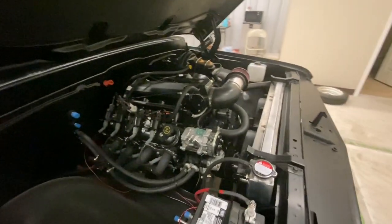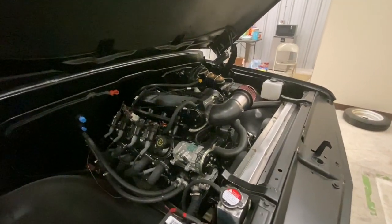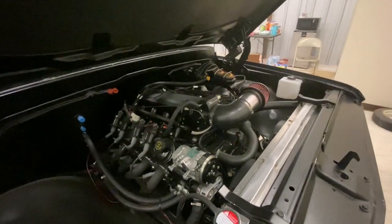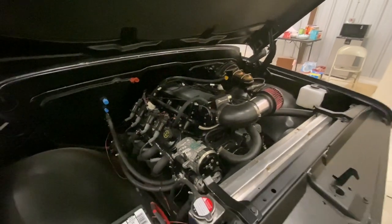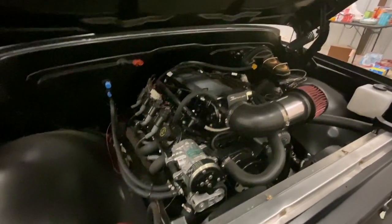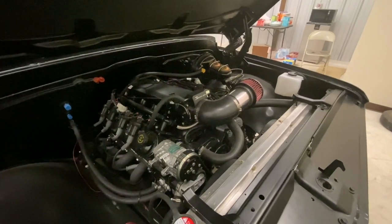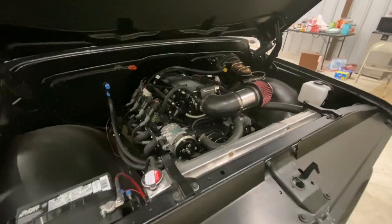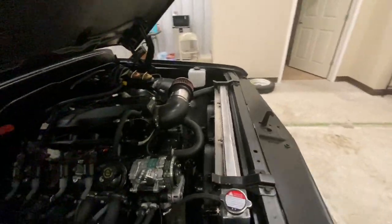And a Holley mid-mount system on the front of the engine, which basically takes all of your engine accessories, moves them up and out from the engine, much more compact with a serpentine belt. And it basically hangs off of the water pump mount. And the water pump itself is a pump that can come in and out without having to disassemble everything. So it's really a nice system. And I went with an aluminum radiator from Summit with dual fans. Cools great.